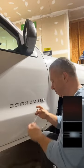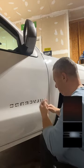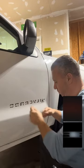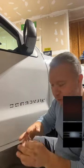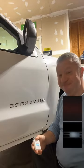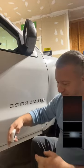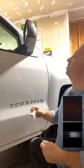Yeah. The big thing with baby shampoo is it has just enough of the lubricant in there, but it doesn't have all of the other conditioners and all the other stuff that goes in a regular shampoo. That's why I use it when I wet sand. I've been using it for wet sanding for 30 years. But what's funny is we used to put it in water to do these washes. We were doing rinseless washes 30 years ago for specific cars, and we would use baby shampoo in the water and actually wash the cars with it.